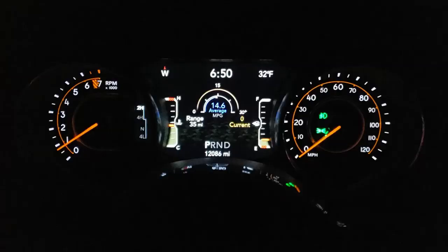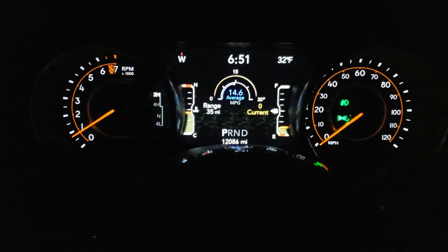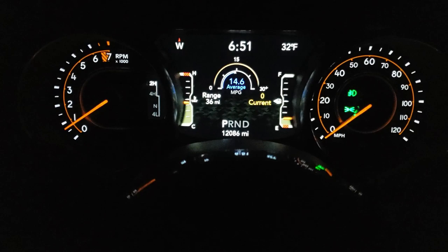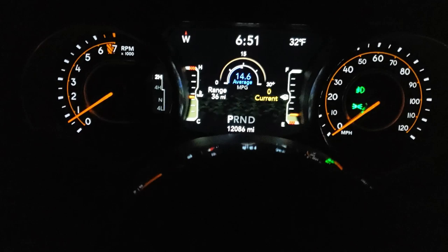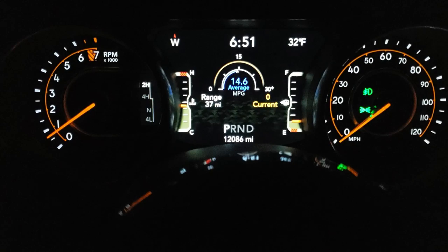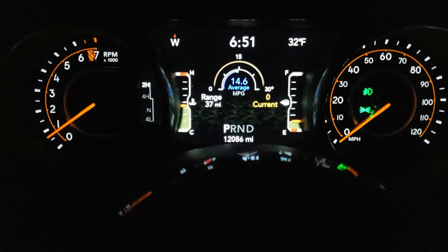One more thing I discovered: if you don't have a trailer connected to the truck, don't press the button down there. You can press that to manually activate the brakes on the trailer if the trailer's hooked up, but if you don't have a trailer hooked up, don't press it — because if you do, your dash will light up like a Christmas tree. The ABS light will come on, traction control will turn off, all kinds of lights will come on. The truck isn't happy with that — it doesn't like it when you activate the brakes on the trailer when there's no trailer back there. So just FYI, don't do that.